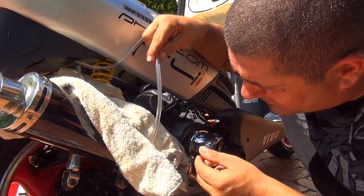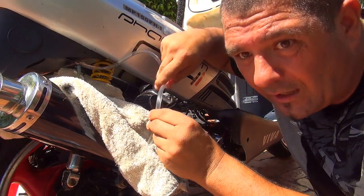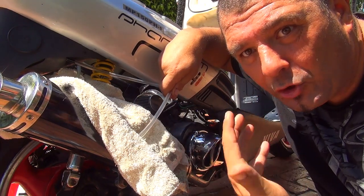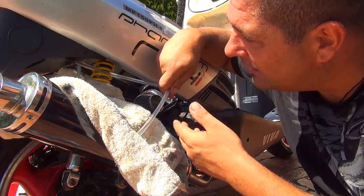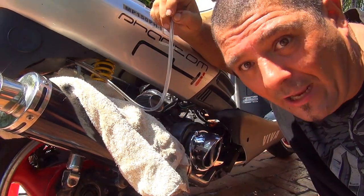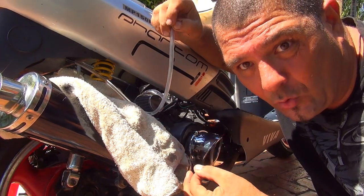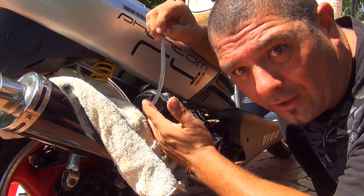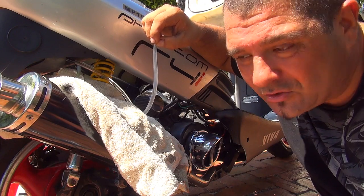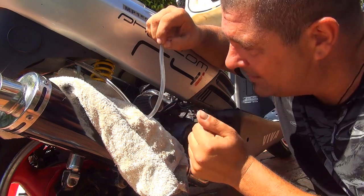Be careful with your eyes — use eye protection and gloves when working with your scooter. Always protect yourself. I use clear hoses because you can see if there is sediment in the hose and see if your fuel is flowing freely without removing anything. Having a clear hose has a lot of advantages.